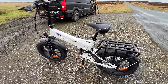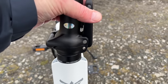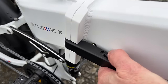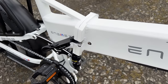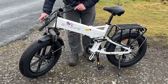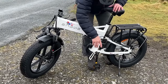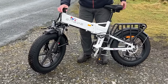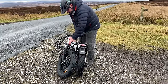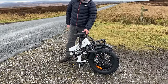There are safety clips on the brackets for folding the bike up - you lift this little lever hook here and they fall down, same on that side, and it clips to fold it in half. Undo these two clips, the handlebars fold over, you can fold the pedals up - these push in and then lift up. Make sure you take the stand off else that gets in the way, then you push the back and it folds around like so. At the bottom, this bracket is designed as a stand to stand it on when it's folded up.